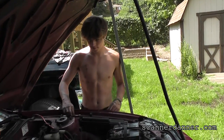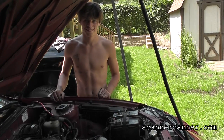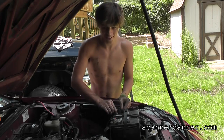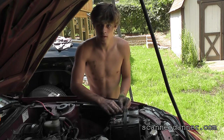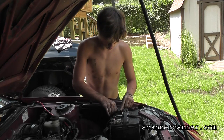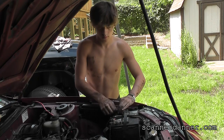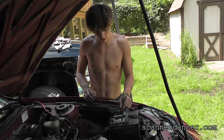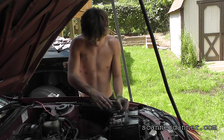That's fine. Put that terminal back on, the negative terminal. You're gonna shock me. No, he doesn't trust me. You don't need to loosen that anymore. You just need to take the terminal, twist it, and push down. Don't mess with that nut anymore. Just leave it as it is. Take that terminal, twist, and push the whole thing. Yep, back and forth. Back toward me. Back and forth like that, and push down. Keep going. All right, that's good right there. Now tighten that up. It just spreads it apart. Yep, wrench is right there.